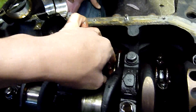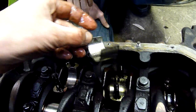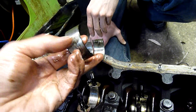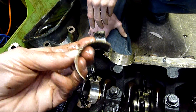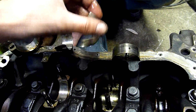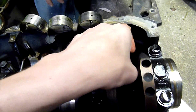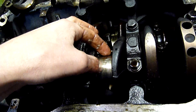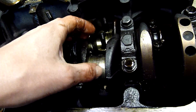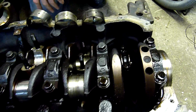Where's the other one gone? Yeah, they were overlapped on top of each other. These edges are all rolled over - they're supposed to be completely smooth and flat. That's the cylinder that died. This one here is also remarkably stiff. It wouldn't surprise me if both three and four were spun. That crank journal is completely rooted.